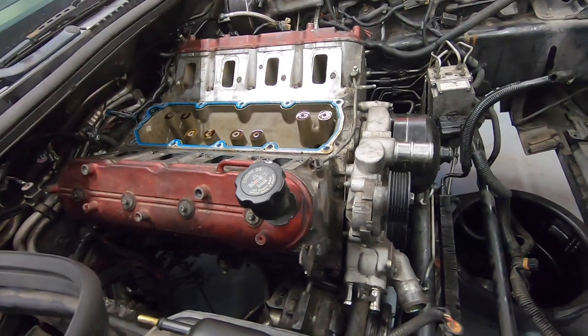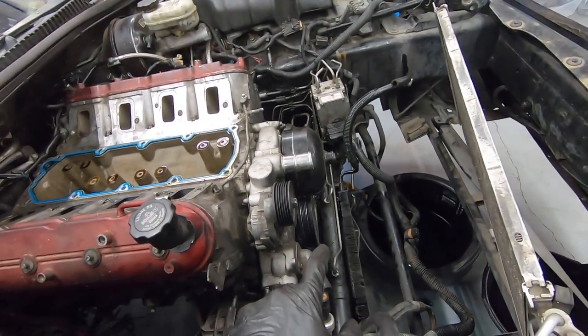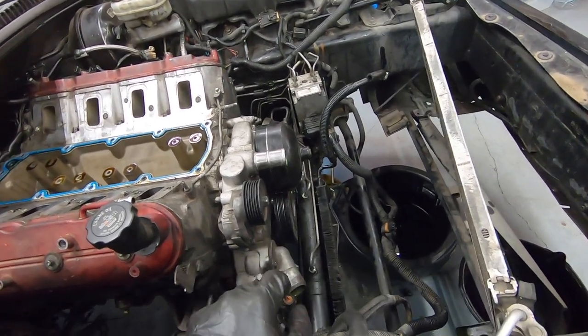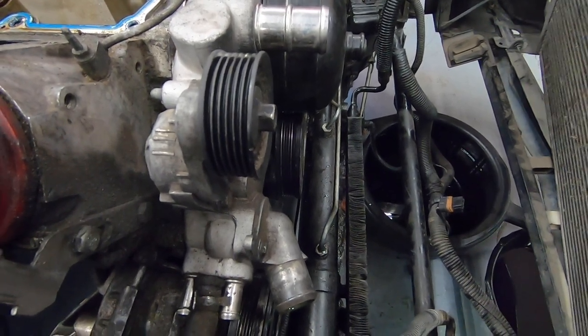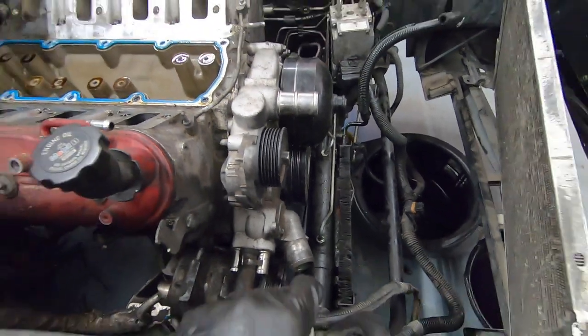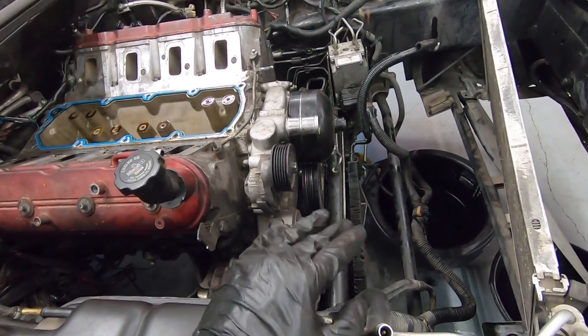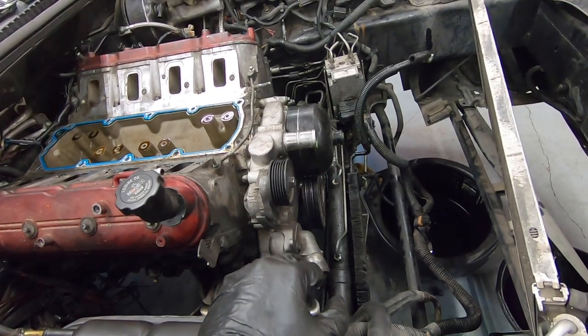So what I think I'm going to do now is look into what it's going to take for me to unbolt and slide forward the rack and pinion, like I mentioned earlier, because we just have like half of an inch of this thing to move forward before it hits that, and there's no way we're going to disengage the clutch out of the torque tube and stuff in that amount of time. So yeah, that's the next thing I'm going to do.